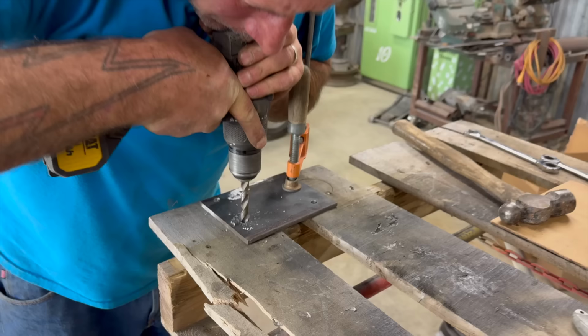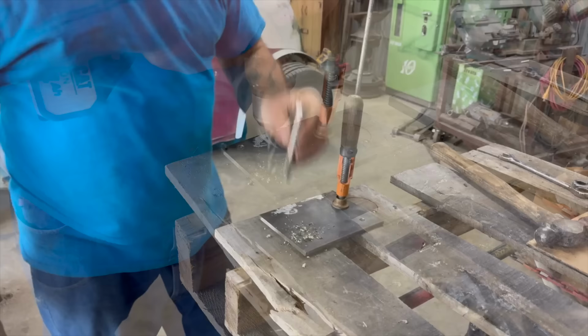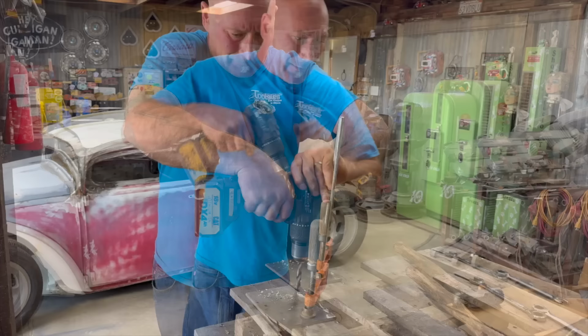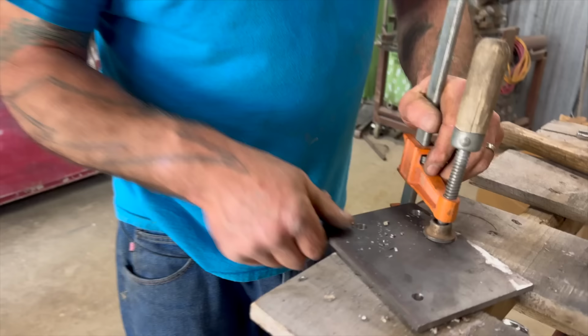All right, got the right size drill on there. It's going to upsize that hole. Perfecto. Today, with all the exciting noises, it's a really aggressively pitched drill bit. So, seeing I had the holes in it already, it's just grabbing a small portion of steel. So that's why it's hanging up.